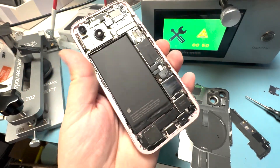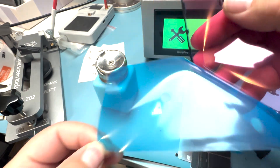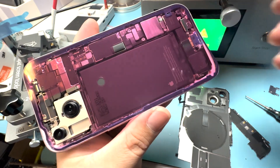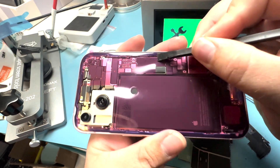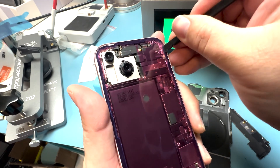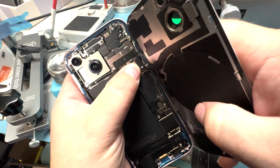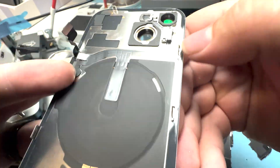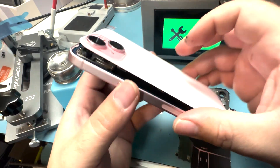The frame is looking really good now. We're going to get out our new adhesive, peel away the glue protector, line it up, and carefully lay it in the frame until it's in there perfectly. Then we're going to take our spudger and go around to really push down the adhesive into the frame, making sure it's making solid contact all the way around. We'll peel up the pink one, connect up the back. I do have to look at this frame — there's a little bit of a bend in some of these brackets, so I'm going to have to bend those back.